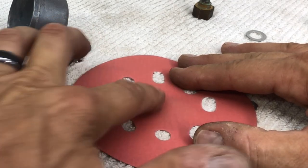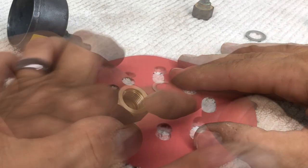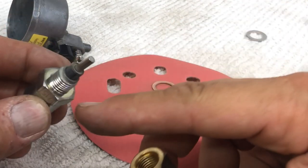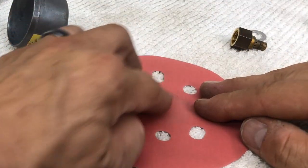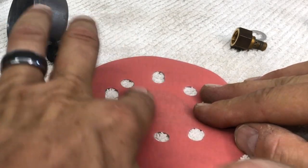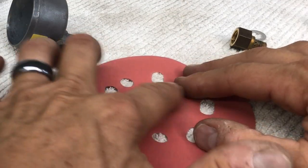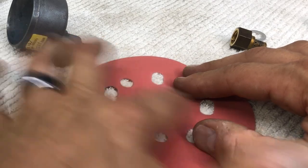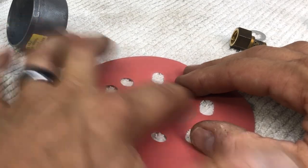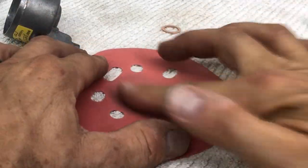The reason we do this is because these copper and aluminium washers are designed to crush up any imperfections along here, around this edge that connects up also with this one. These crush washers are designed so that when you tighten them up, they squash into all of those imperfections. And of course, it's practically impossible to put the washer back on exactly the same way that you took it out. So just be a little bit patient, go round, make sure that all of the imperfections are off. I'll do the same with this one. I've got three to do.